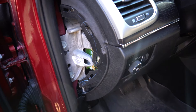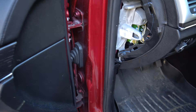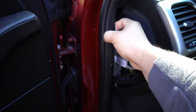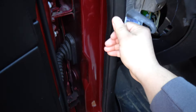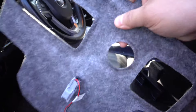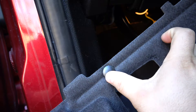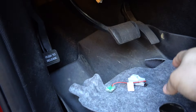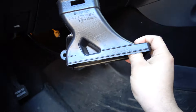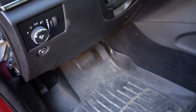I've already gone through here — I popped this cover off, it literally just pops out. You pop it out and take it out. I think this weather stripping has to come off like this, you literally just pull it off, and then this part comes out. I also took this little panel that goes all the way under here — it just has these two plastic clips, one here one there, so you just pull them down with the trim tool and disconnect this connector for this little LED light, and this comes out.